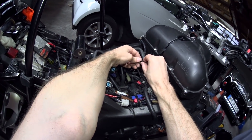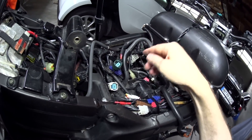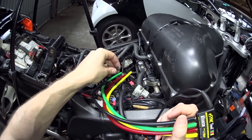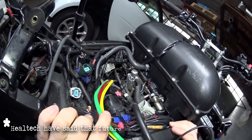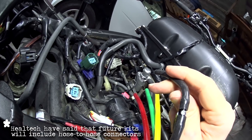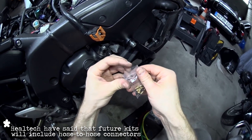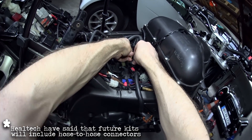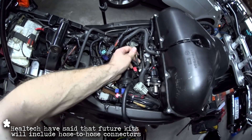That's just a completely blanked-off peg to hold the hoses together — there's no air passing between them. This is where we're potentially going to have a bit of a problem because the hoses on the end of our e-sync tool are intended to pop onto some kind of a nipple, and obviously we've got just an ordinary end of a hose. With better access we could get right in there and poke this straight onto the nipple on the throttle body, but we don't have better access. One thing I could try is to take these M5 threaded nipple adapter jobbies, thread that onto the hose, screw it on nice and snug, and see if it does the trick — if not I'll have to find some hose connectors.